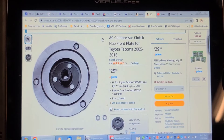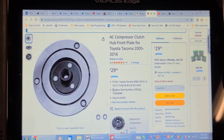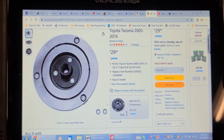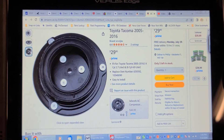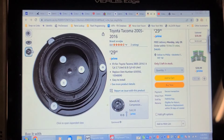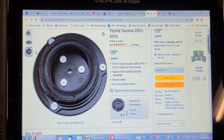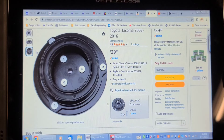This part says it fits a 2.7 and a 4-litre, but this is actually a 3.6, so I'm hoping it's going to be correct. It looks correct, and all the other listings show the same fitment from 2005 to 2016 — I think around 2015 or 2016 they went to the 3.6 from the 4-litre. The truck can be driven with the drive plate off because the bearing is still spinning free and smooth, so we'll just put this drive plate on and establish the air gap.